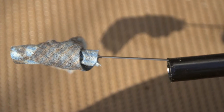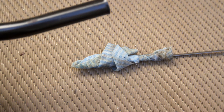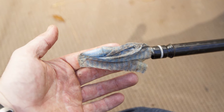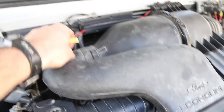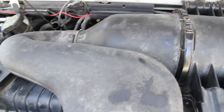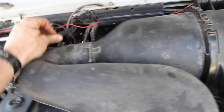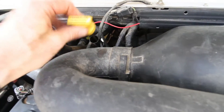I don't know why that stuff is forming in there — whether there's not a good seal at the top of the dipstick tube and condensation is forming and rusting the interior, I'm not sure. Anyway, once that's clean, putting it back is real simple: just put those 10-millimeter nuts back on and reconnect the electrical connector. You can see it made a huge difference — coming out now I don't have anything on the dipstick except fluid, which is really what you'd expect. If you have the same problem, hopefully this video helps.